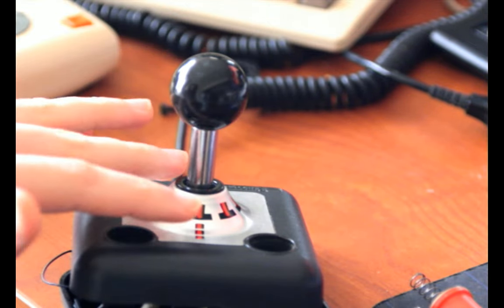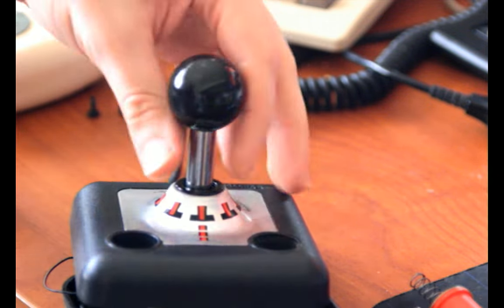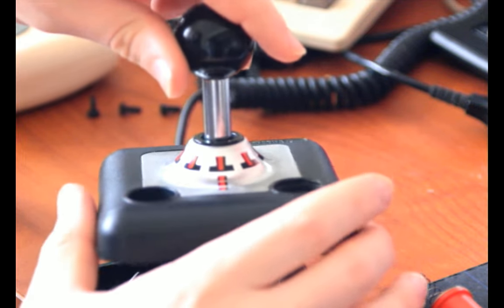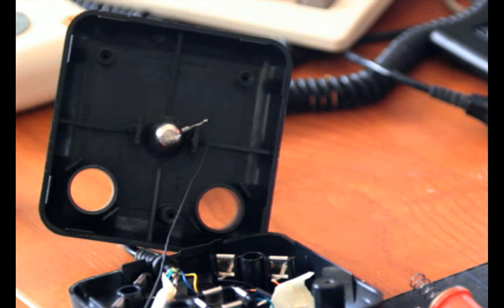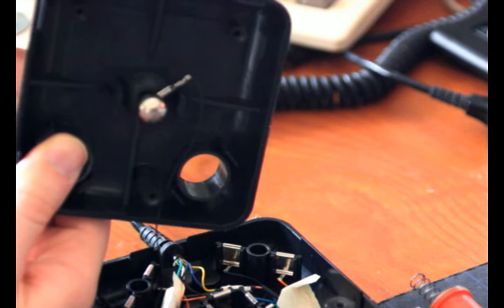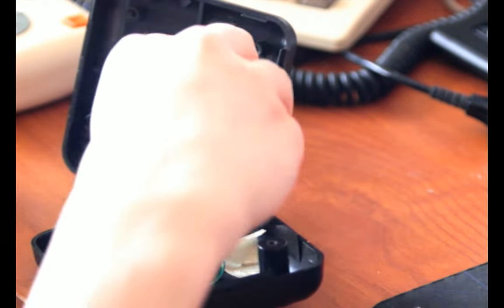So if you're going to replace the tire valve because you have a broken one of these, which I don't know how you did that, but I guess it's possible, then just note that you'll have to figure out some solution for mounting the ball on top, because I don't think anyone makes the TR-418 tire valve, which is what this is, with the kind of threading that this uses anymore. But yeah, it's literally just a tire valve, a little piece of rubber that likes to snap back into the center, like it does on a tire. And I think that's a really clever design. I really appreciate whoever thought of that.